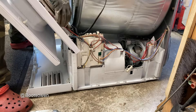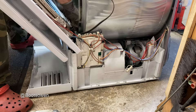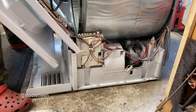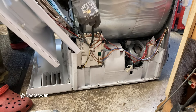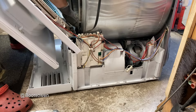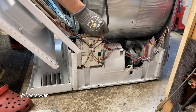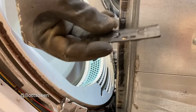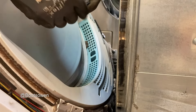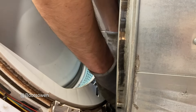Something's come off — there's lots of pads there. I'll have to fish that out, it's a bit of a disaster. Let's put the belt on first because that's step one. This piece of plastic here is one of the bushes that the drum rides on — it's got to click in like that.